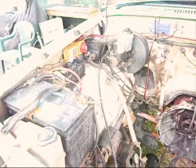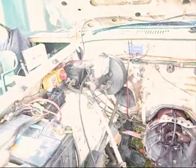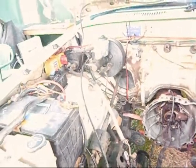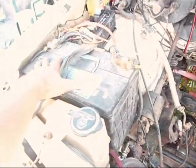You can either run it through a voltage converter, so basically you have one main pack, and then you have a voltage converter that converts that to 12 volts, and that runs your main system. I'm just keeping it simple. I figure I'll keep that big battery pack for my motor alone, which will be going there obviously, and keep the standard dual battery system to run everything else, because that way this big battery will be powering my alternator.